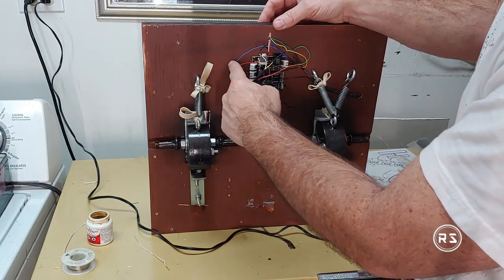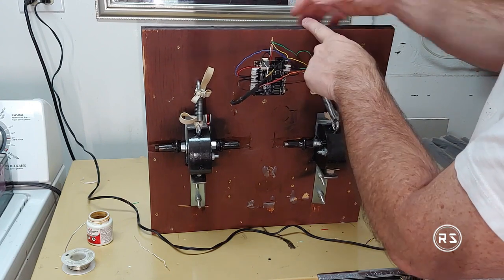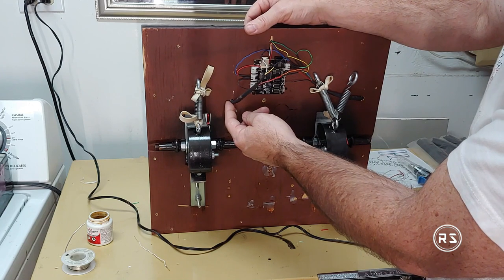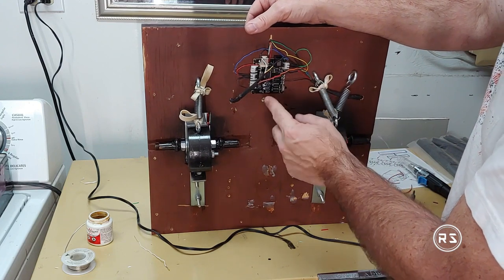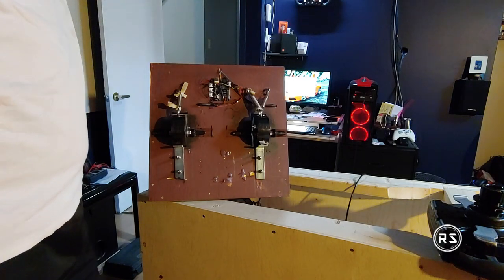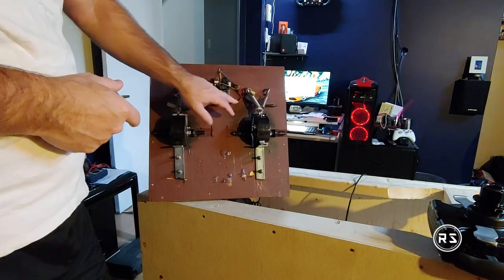On the other side I had the red doing the same thing - a loop between the Thrustmaster harness going to the accelerator and looping back to the brake pedal as well. The blue is the controller of the brake pedal, so it goes on the brake side plus it's a Y going to the Thrustmaster harness. Finally the black, which is negative, goes to the accelerator side, does a loop going back with the green - they're all connected together as a Y going into the Thrustmaster harness. Finished connecting all the wires to the USB controller chipset. I glued the wire on the board so nothing will disconnect. We are ready for testing.